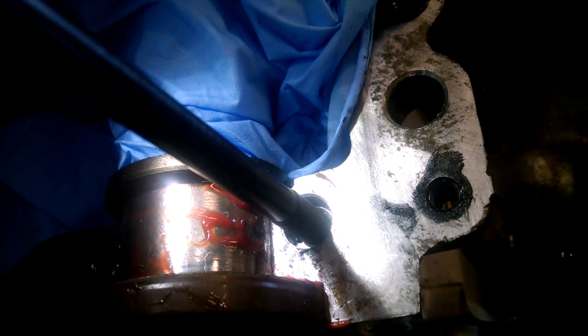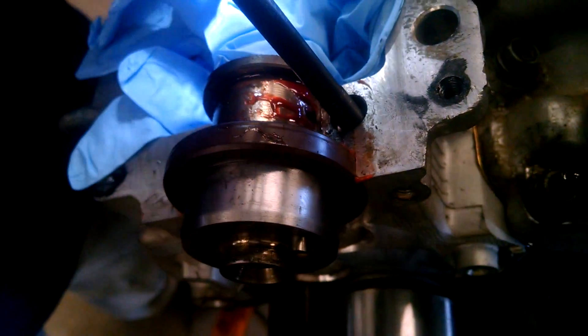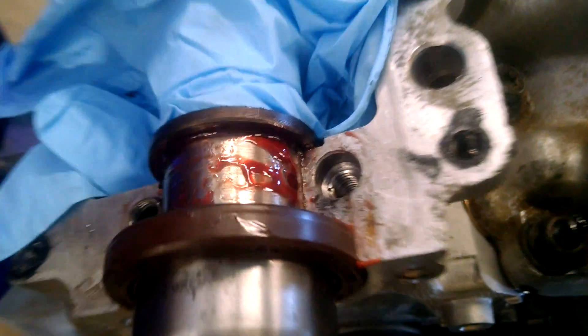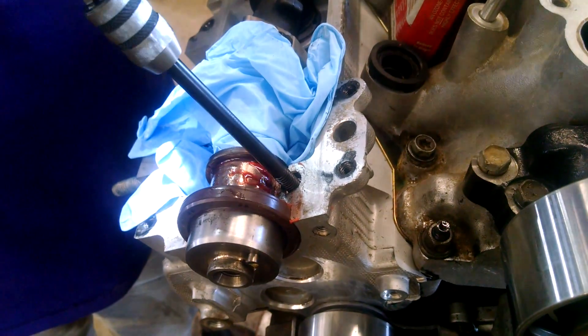You can see the coil's almost all the way in — a little bit more, maybe one more turn, and another half a turn. That'll be good. You can check it out — looks good. We want those threads to be backed up on the aluminum as much as possible, so go in maybe one more half turn.